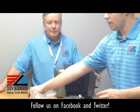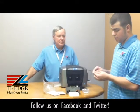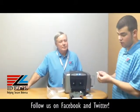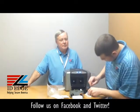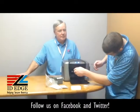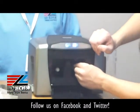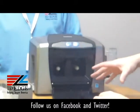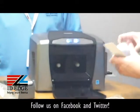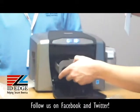Next, take one of the swabs and bend it in half, or squeeze it — as long as you hear a snap. Go ahead and pump it a couple of times to get some alcohol running into the cotton. Inside the printer there's a little triangle bracket, and on top of that is where the print head is. Run the swab back and forth a couple of times to get all the dirt off. Let it dry out a couple of seconds, then put the cards back in and put the ribbon back in.